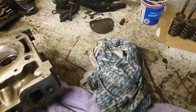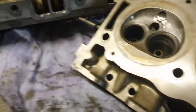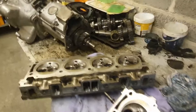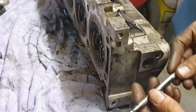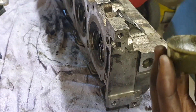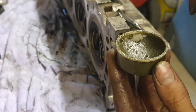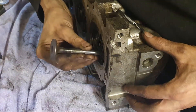When you've ground the valve you end up with a much greyer finish. So that's got quite a dull grey ring there now, and it corresponds with the head as well — those have also been ground, so they've lost their shine and they're a bit greyer. I'm going to go ahead and grind the last eight valves on that head. I've got the cylinder head on the side of the bench. I've only actually needed the fine grinding paste, so I'm just loading up the edge of the valve with some grinding paste.